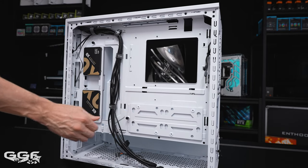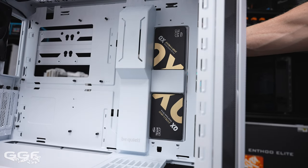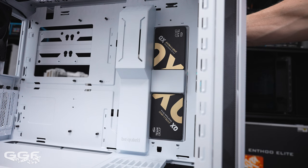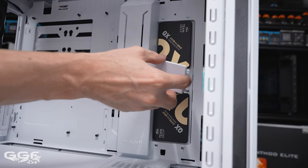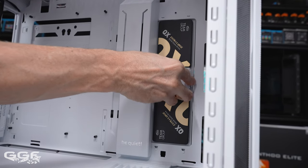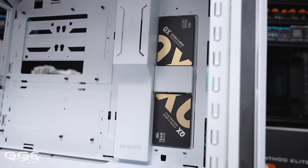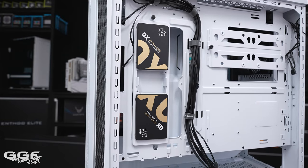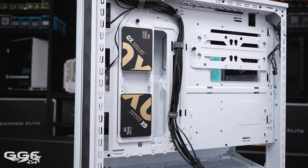The drive could stay in place via the top hole but was not properly secured. This bracket can also be moved lower. The final storage spot is beside the cable management bar on a removable bracket supporting two 2.5-inch SSDs, installed so data and power ports face each other and covered by a neat cable cover. I like this idea, but having one SSD always upside down may be a bit OCD-triggering. Personally I'd just install the SSDs on the backside of the bracket unless you have RGB SSDs.